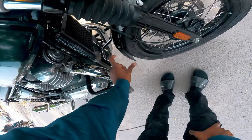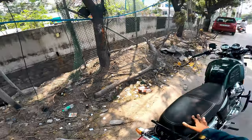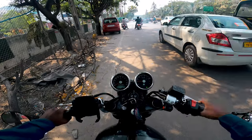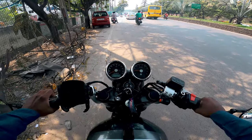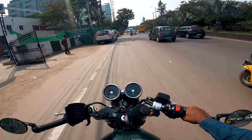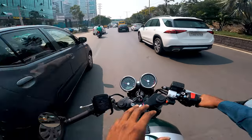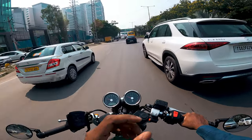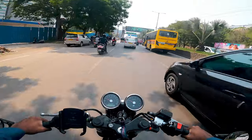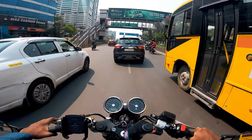There's a round black-colored thing — that's the oil filter. To check if it was changed, look at it: if my bike was not serviced, the filter still has old scratches and marks on it. If it's a complete jet black color it may be new, but if it has scratches and marks it hasn't been replaced. If you find the oil filter not replaced at the service center, you can request direct billing for it. You can definitely use this check.